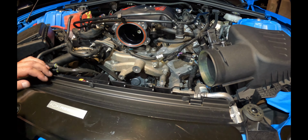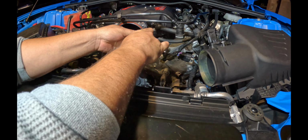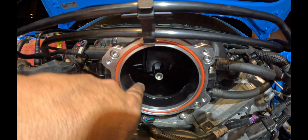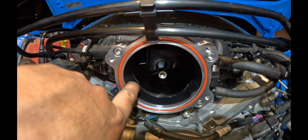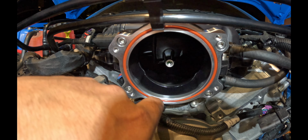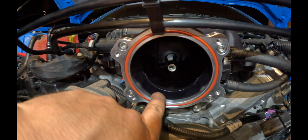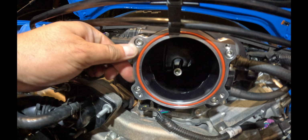And I have to say, guys, Solar Performance makes great products. I like their adapters. They're really nice. There's definitely some opportunity here. Like I said, we could remove the flashing from the manifold. We can actually port match our Solar Performance adapter to match the manifold. It matches pretty good in some areas, but some areas not. So, I mean, can't get too picky with it. All of these fit really, really good. Top, the bottom. This one's a little bit off. But this is not too bad.